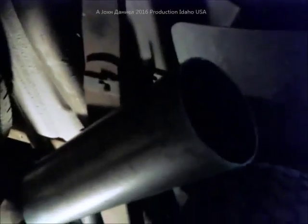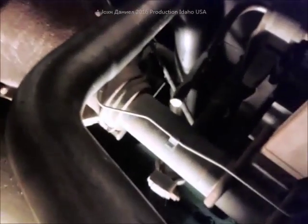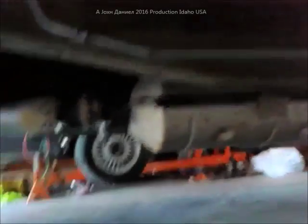I can spin this whole piece, and in my case this is going to be the completion piece that will be put in. It clears the back tire by about seven and a half inches and I'm going to put a specialized tip on it. I won't actually need the rear-exit piece - I'll use this one and it'll do the job. We'll fire the truck up, tighten everything down. You can use your original hanger positions and add to them if needed. This is a hundred-dollar kit to put a three-inch exhaust in a Ford, Dodge, or Chevrolet.